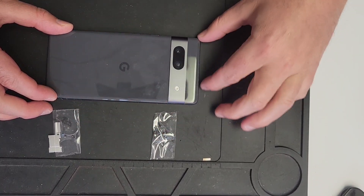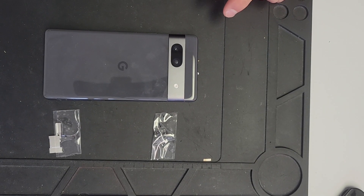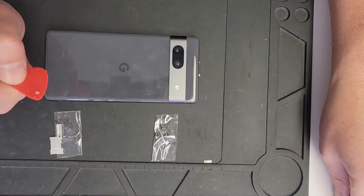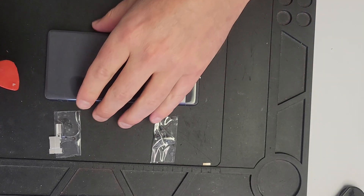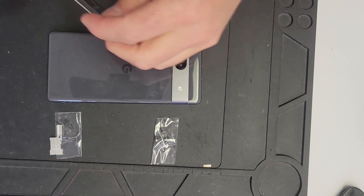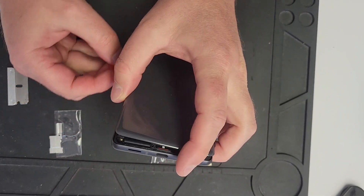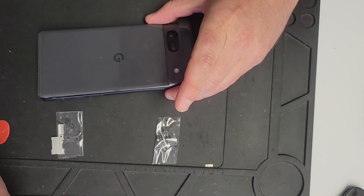So the back is plastic — it is not glass. You can pretty much get into it with a razor blade and then heat it up slightly. Use a hair dryer if you're at home, or a heat gun, or a heat pad is best. Then get underneath it with the razor blade, get a little bit of leverage, and force your pick in there. Work the pick around the sides like so — it's really easy, nothing compared to some of the other phones.